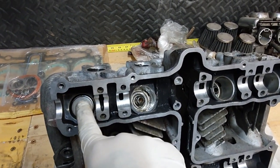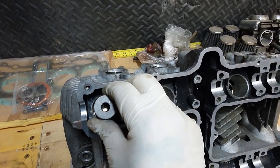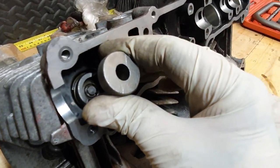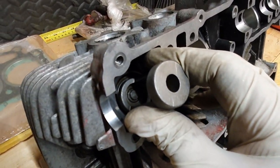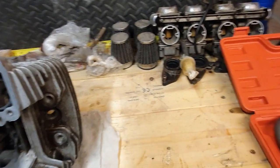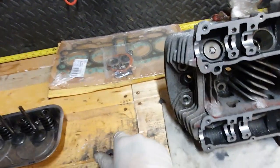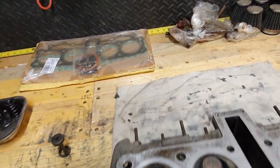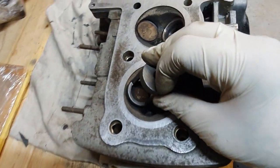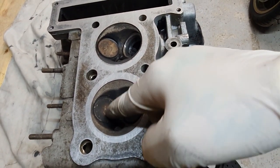The keepers are these little pieces here. This is the right size for me — fits right over the valve and gives me enough space so that I can remove the retainers. On the other side just use a good size that will fit over the valve, and it will keep the valve from coming out.